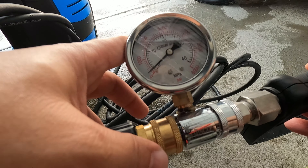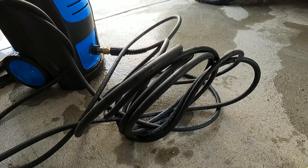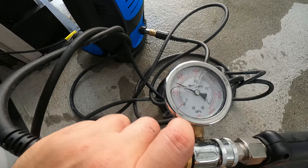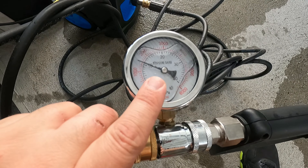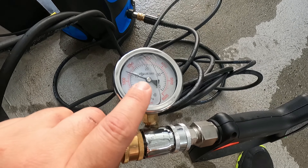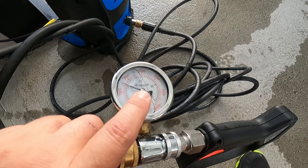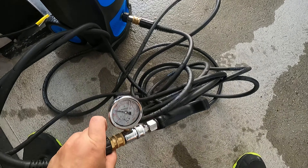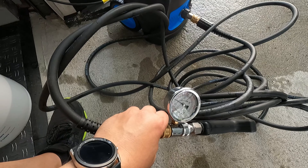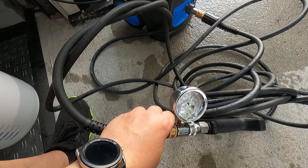That's not too good. If you put a different nozzle on to allow more water flow, your pressure is going to drop also. Look, it's doable for car washing — 1,000 PSI for car washing is actually fine. But for cleaning cement, siding, and house cleaning it's not great. This is more for washing your car, but you're not going to get extreme water flow out of this one. You'd want at least 2 GPM, and you're only getting 1.2 gallons per minute with this.